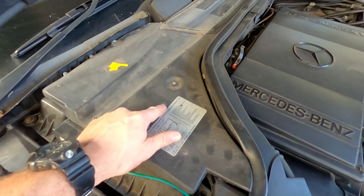Now that we've got the panel off, you're able to access your cabin filter. I suggest either cleaning it out or replacing it at this time. Mine was replaced not too long ago, so I'm just going to dust it out and set it to the side. You can now access your blower motor, which is up underneath this assembly here, and this is the piece we're going to be changing - the blower motor resistor. Very simple to take out. First, I want to test our blower motor, because if the blower motor itself is bad and you replace just the resistor, it could be frustrating. You'll know if your resistor is bad if the blower motor kicks on when tested directly with a battery.